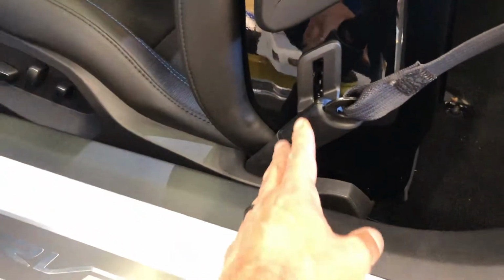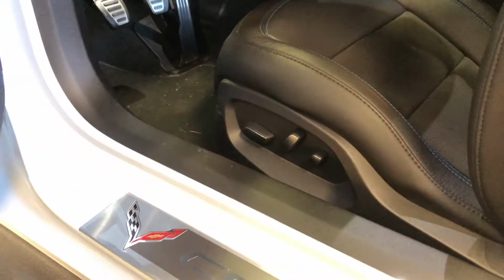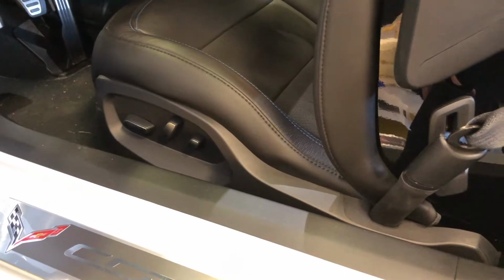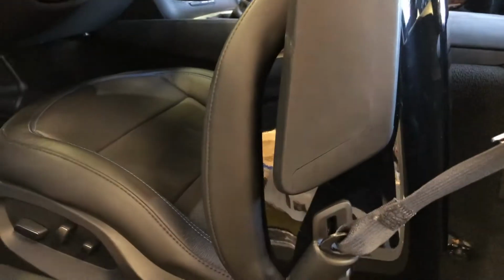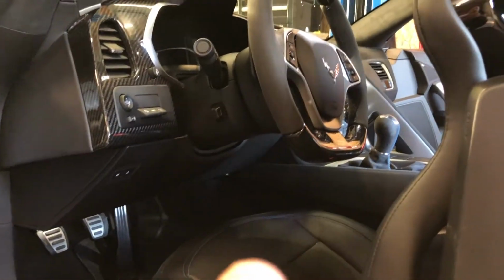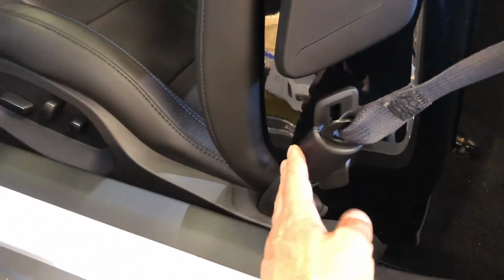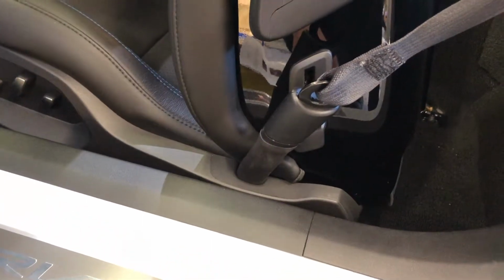So it's pretty straightforward. The first thing we do is we remove the seat belt from the seat here, and then we're going to run the seat backwards and forwards to get access to the bolts that hold the seat to the vehicle in the rear and in the front. And then you unplug the battery once you've used the electric seat adjuster to move it backwards and forwards. You'll unplug the battery, disconnect the seats, and then they have you remove the seats from the vehicle, which is not too difficult, I don't think, because we're going to take that Targa roof off. So it'll give us plenty of room to pull them out. Driver's side will be a little bit harder because you have a steering wheel to deal with, I think. And then you attach the brackets to the seat by removing some of the hardware that the belts use. And then from there, you put the seat back in, reattach things, and reconnect the battery.